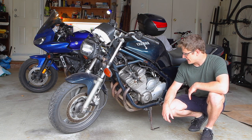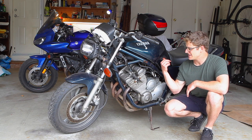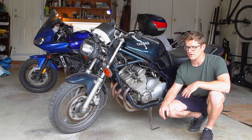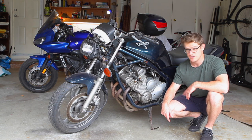The clutch makes a clattering noise when you get it onto idle. I have had this running — not through the gas tank, but with a syringe of fuel into the fuel lines to fill up the carburetors. It has idled, but when it does get low in the RPM, it clatters away and makes kind of a bad noise. So we're going to find that out.